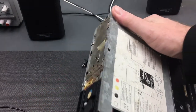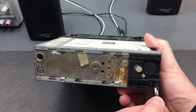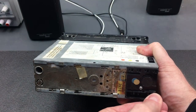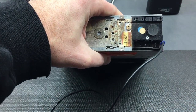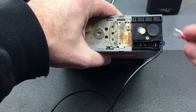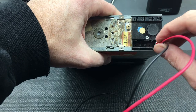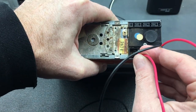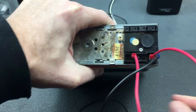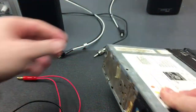First I'll turn this around. Starting with the earth or ground connector, which is the last one on the end — I'll plug that in. The next one over is the power that operates the unit; this is a slightly wider spade plug. Then there's a slightly narrower one needed here as well. I'm not going to use the pass-through. So that's those three — pretty easy. I'll do the antenna as well.